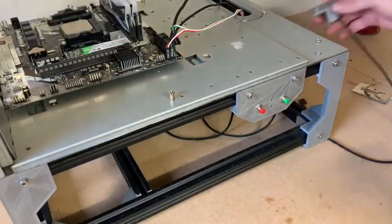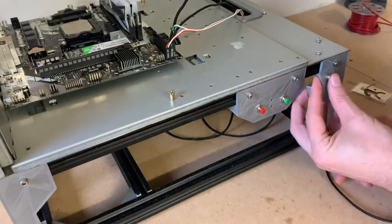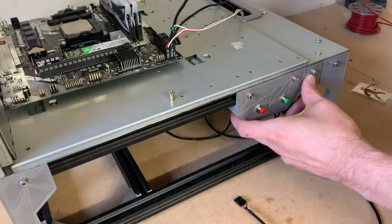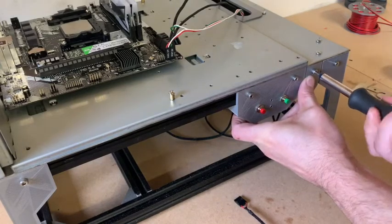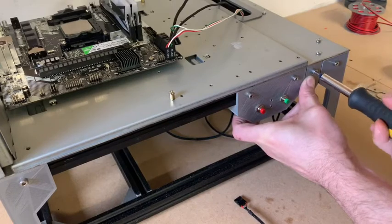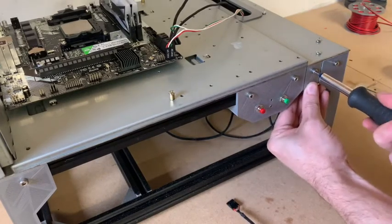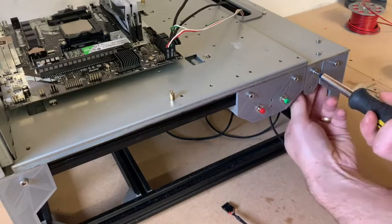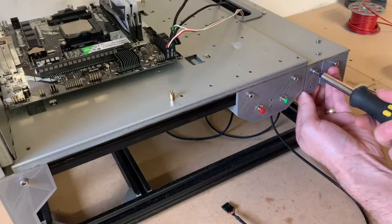So to install the speaker into the frame, we just take the T-nut and we locate it into the aluminium extrusion. As we tighten up the nut, the T-bolt will turn and then it will actually grip hold of the aluminium extrusion and it will hold it into place. Using this kind of design allows us to be able to move the speaker anywhere we want, because we can just simply undo it, it'll come out, and then we can adjust it around somewhere else.